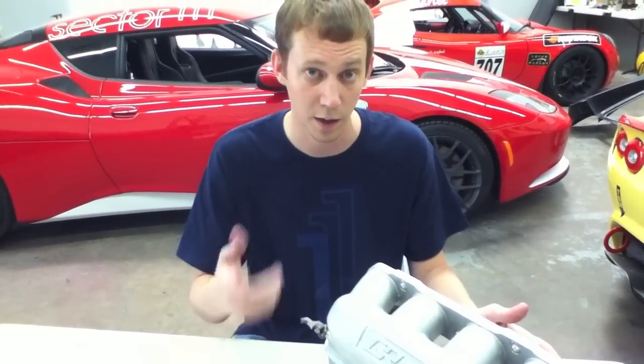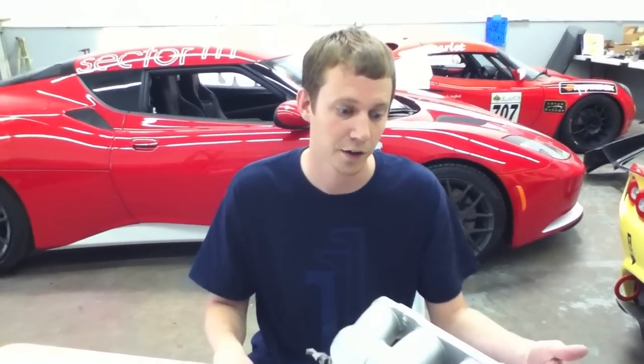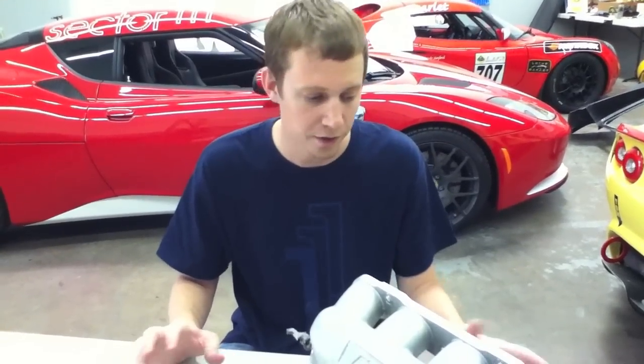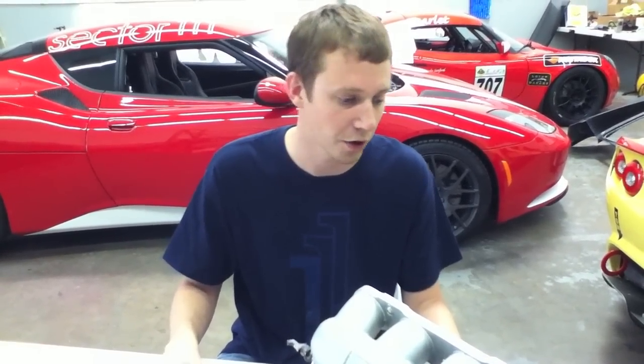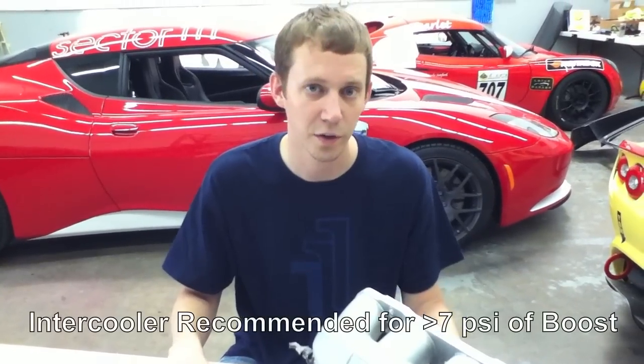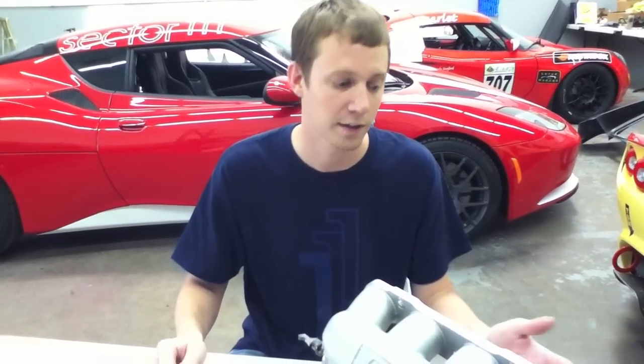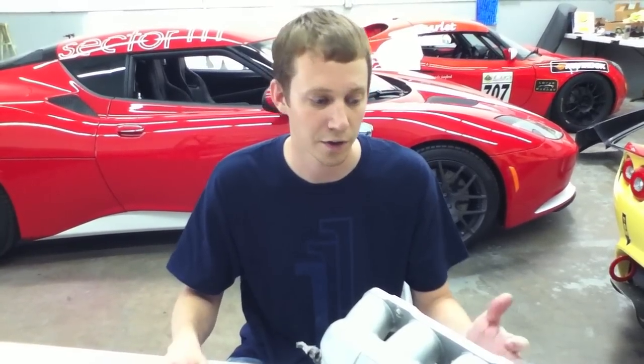The purpose of that heat exchanger is to take the temperature rise that naturally occurs with the increase in pressure and reject that heat out so that you have a denser, cooler air charge going into the engine. The basic rule for when you need an intercooler is once you get above 6–7 psi of boost — which is half an atmosphere on top of normal levels — you start generating enough heat where you really need to start considering one. The Katana kit stays below that level to be simple, affordable, light, and in keeping with the Lotus approach. But if you start making more power than that, you do need an intercooler, similar to what the supercharged factory cars have, where they're making higher than 6 psi of boost.